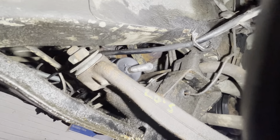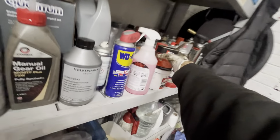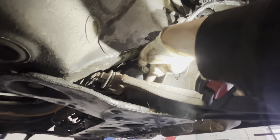Okay, boot number one. Oh, look at that. All right, doesn't fit as good as an OEM, obviously, but I can still get on this spanner holder to adjust the tracking. First step when you're working on an old car, any car that requires it, with stuff like tracking, I like to get your copper slip and paste all these, because this is all adjustable, and the last thing you want is for this to not be right. So you get that, you get your locking nut, and the next step is 20.5, lock it off.